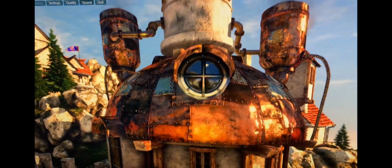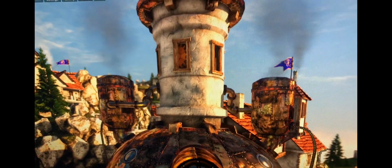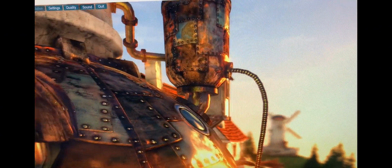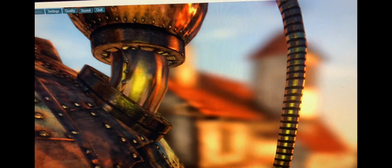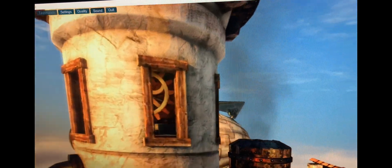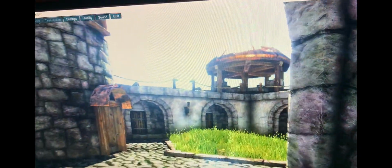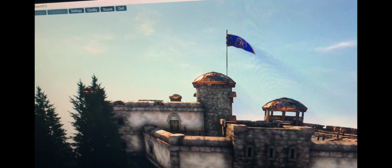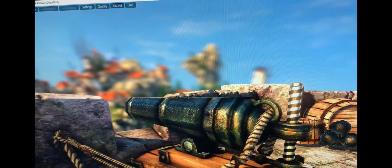So here's Heaven running at 1400 megahertz, which is less than the base clock. It was doing well. I did FurMark at the stock clock and I was running Heaven for a few minutes and then it just crashed. So going a little bit under now, we're at 1400. Seems to be doing well, but the performance is bad. The FurMark score was terrible. So it seems like this GPU is somewhat disabled, but if we can make it reliable at some sort of speed, I'll be happy.